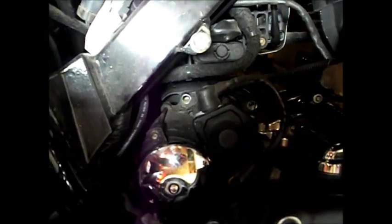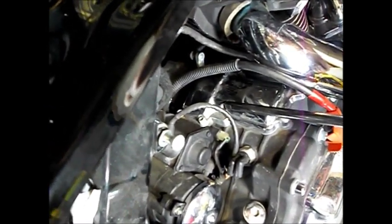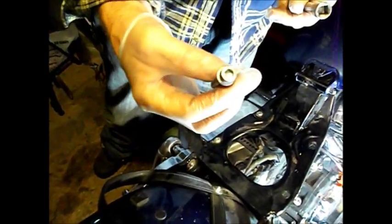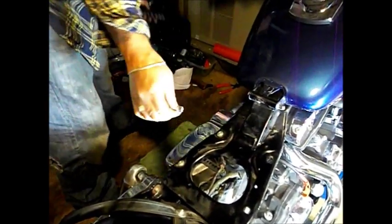So those are out. I'll show you where those are real quick — this is one bolt hole, and here's another. With the battery box out of the way and also with this vent out of the way, it made it easy. You can see the primary itself is loose, which allowed just that little bit of movement and made a really pretty big difference. The bolts are quarter-inch hex, and believe me when I tell you, get the long hex — not these short ones — get the long ones to handle this stretch. Believe it.